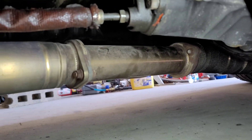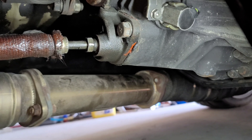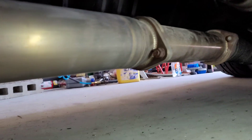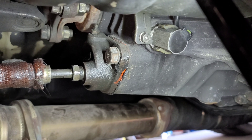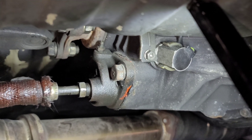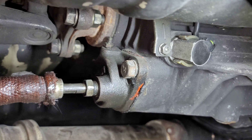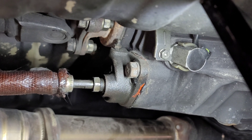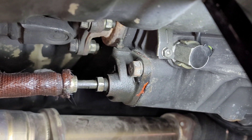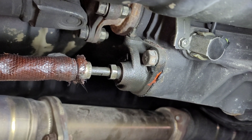So here we go. I've got the car on, connector disconnected - it's the brown one for the R33 - and right now it's pressurized, kind of in bleed mode. What I'm gonna do is, while it's in bleed mode, like with brakes, loosen the bleeder and it's gonna shoot out either air or fluid, then tighten it back up. Then turn your key off, leave it off five seconds, turn it back on - it's gonna engage bleed mode again. Once it's pressurized, loosen and bleed again. Keep doing that until nothing but straight fluid is coming out.